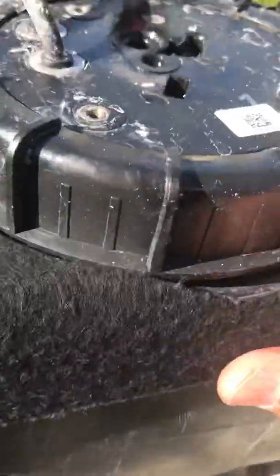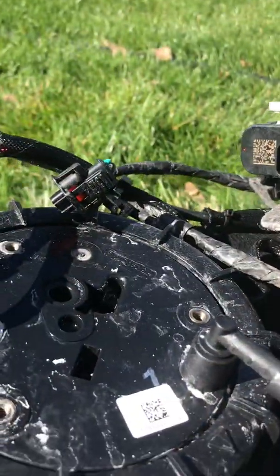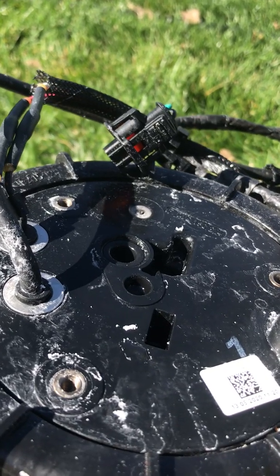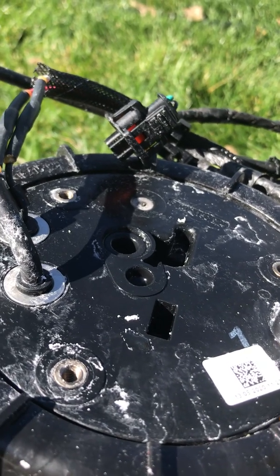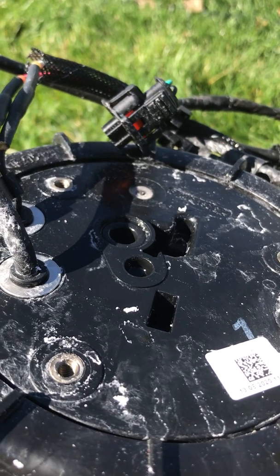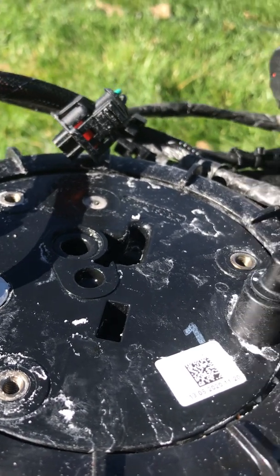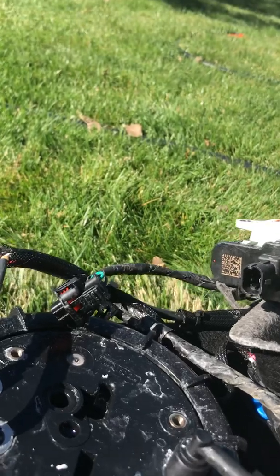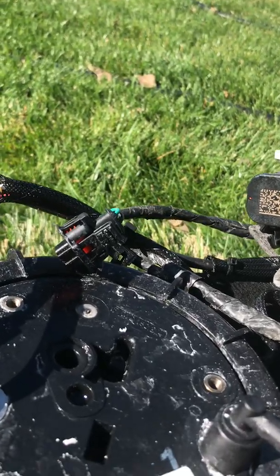And in doing so, before I put those O-rings on there, I put this assembly back together. There is DEF fluid in here. I tipped it upside down, and I got a drip or two. 1-2 drips is all you need for this to be a giant salt crystal mess. So I knew that I can't put it back together that way. So I did this O-ring deal, sprayed them with silicone, put the assembly together, flipped this tank upside down, and I have no leaks now.